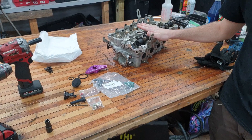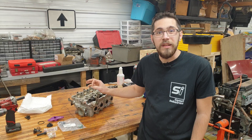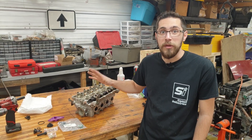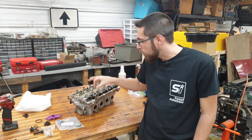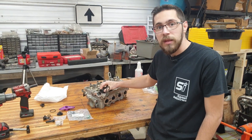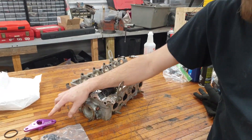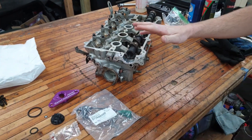This is going to require you to drill a hole in your cam. What this kit does is give you a plus one, or single tooth, cam reference so that you can send your cam position to your aftermarket ECU. This is not a direct replacement for a CAS or distributor and will not work with a stock ECU. We take our cam that drives your CAS or distributor - in this case a 1.6 head, so this is the intake cam; if you have a 1.8 or BP, it'll be your exhaust cam - and we're going to add a dowel pin. That dowel pin along with our bracket will allow us to sense that single dowel pin as a plus one reference, and the kit comes with everything you need to do that.